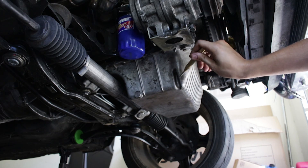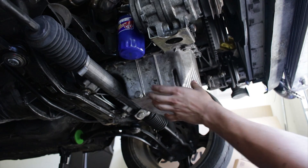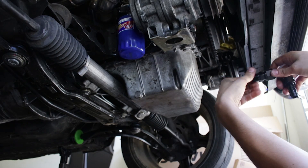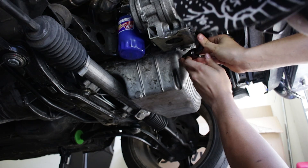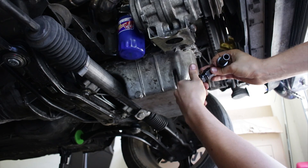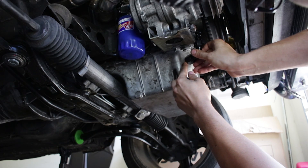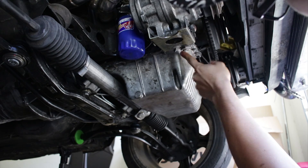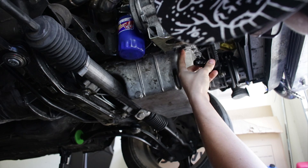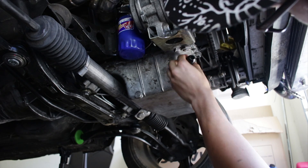Make sure you have oil in the pan first — this is critical because you don't want metal shavings just sitting in there. With oil in the pan you can drain it and hopefully get most of the shavings out. Next, get an idea of where the fitting is going to sit — mine will be somewhere around here when it's tapped in. Also make sure the fitting position is not in the way of an oil pan bolt, so you'll still be able to get the oil pan off without removing the fitting.